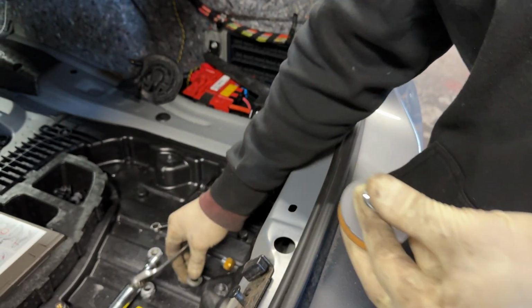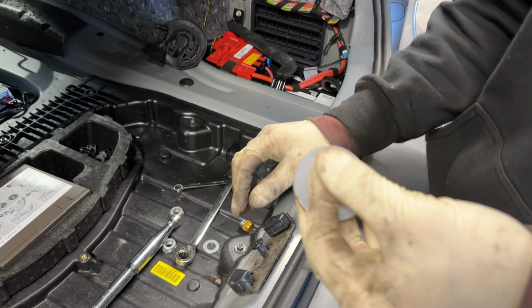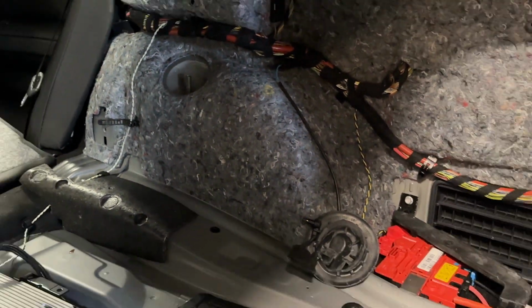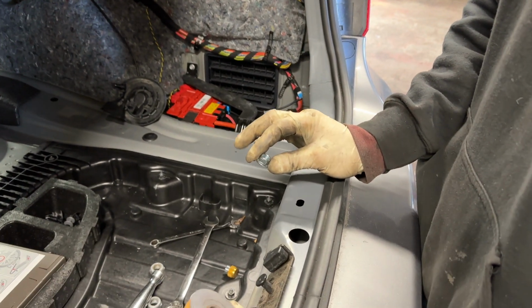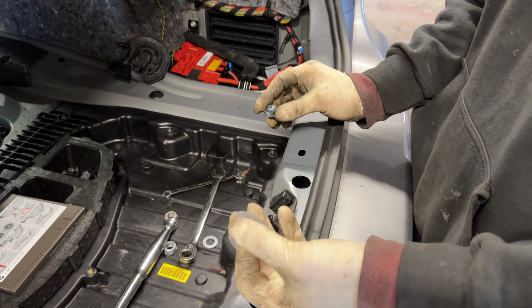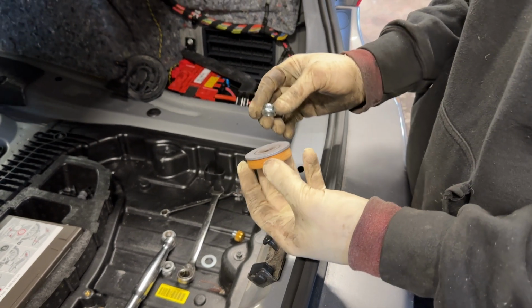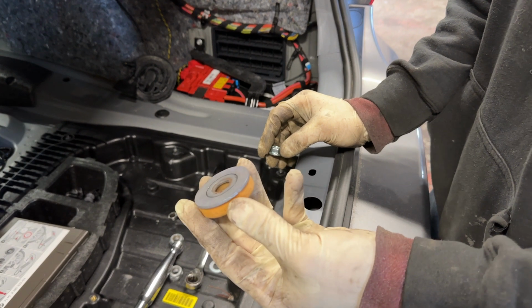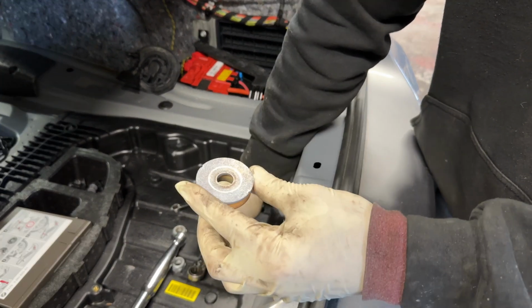But once you have the bottom end all assembled, you'll notice that the actual strut tower, the actual shock, is poking through, and you're ready to finish the assembly. For this part of the installation, you want to refer to your manual, the user manual for the specific kit that you may have. In this case, Öhlins called for us to reuse this washer and bushing that we retrieved earlier. We're gonna put that in first.